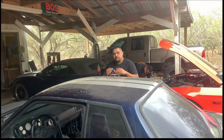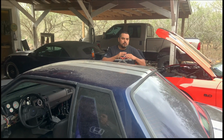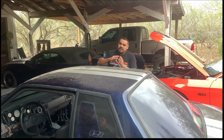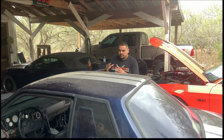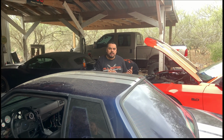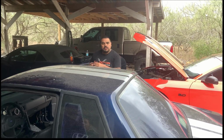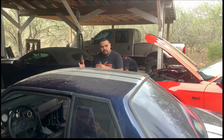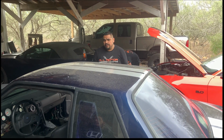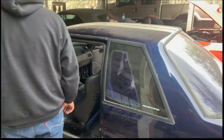Fueling through the RPMs is fine, but remember, we didn't add any load. This was all neutral. And the reason we do that is because we want to make sure first that at a little bit higher range into the RPM, fueling is a little bit better, but it won't give us proper readings until we actually put load onto it. Yeah. Because when you put load into it, we're getting more air, the engine is requiring more airflow, right? So that's when we'll know how fueling is within the RPM with load. So we'll go ahead and do that now. All right.